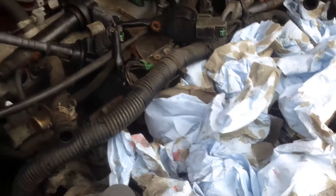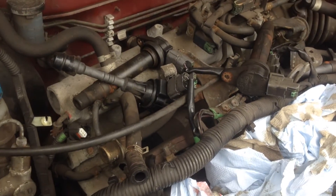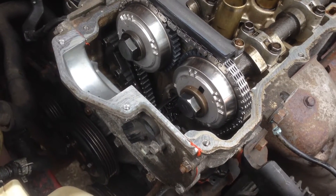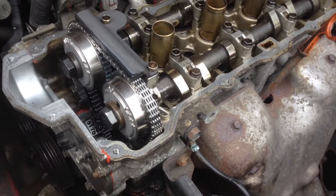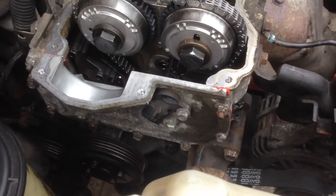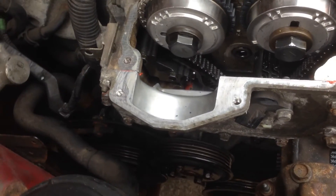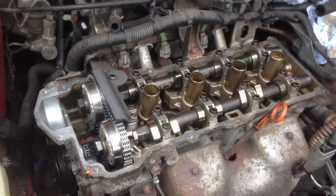I won't be far off firing it up now. I've just got to put this side cover on, get the belts on and well tensioned, rocker cover on, and all that. I've got the side cover on now, put the accessory belt on for the alternator, and reattached the engine brace at the back underneath. Now I just need to put the water pump and power steering belt on, and the cam cover.